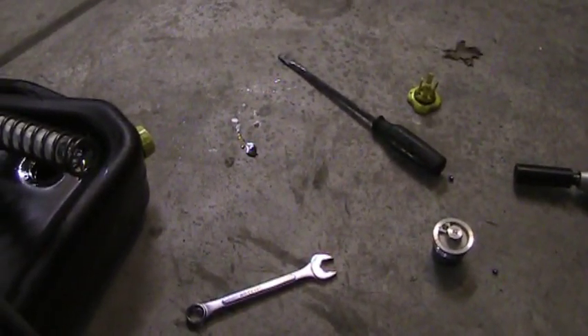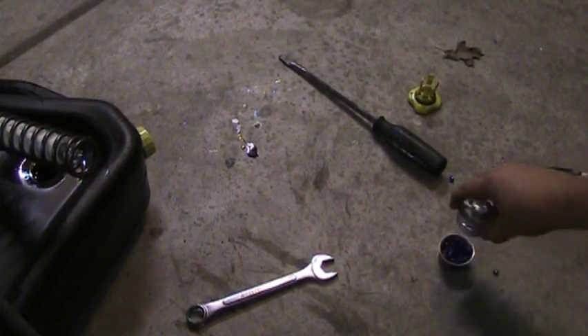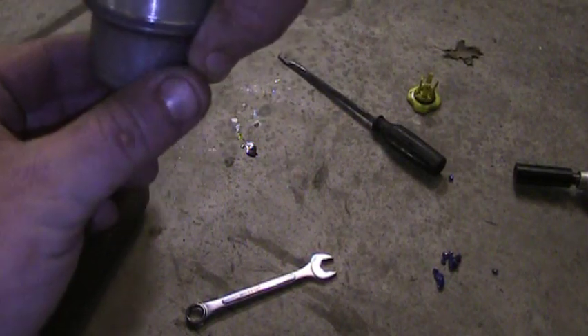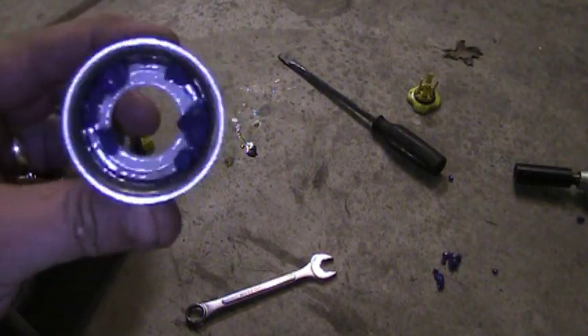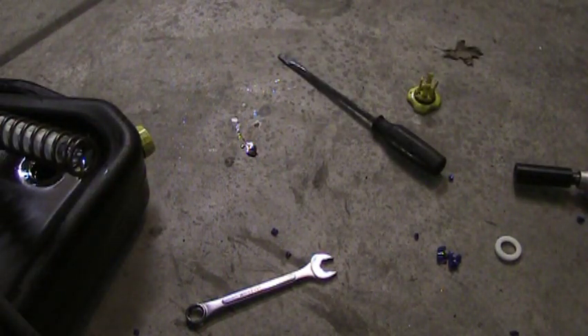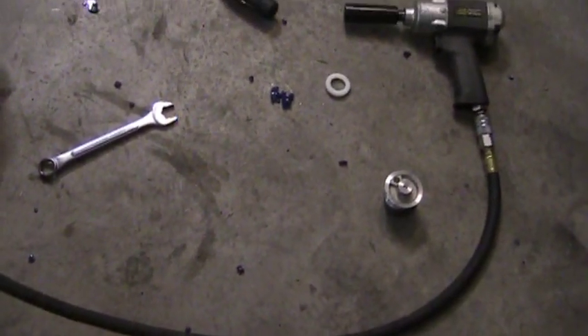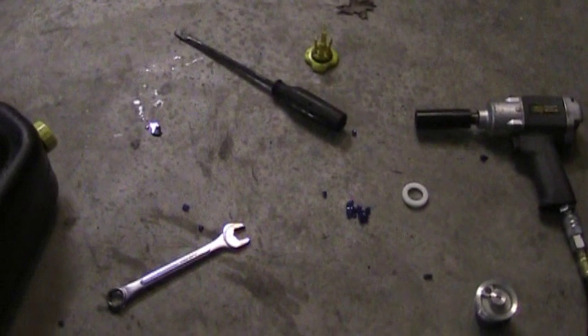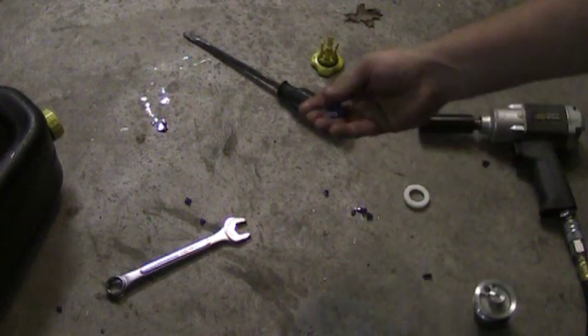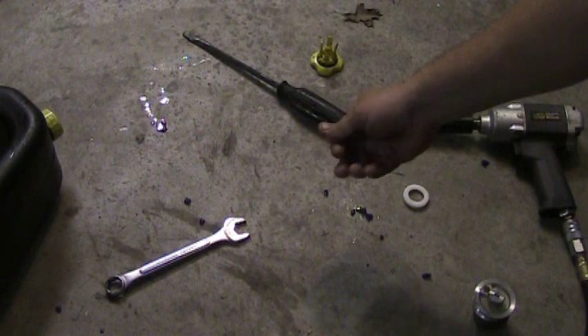When I first opened it up I was like, what in the heck is that? At the top, you've got the outer casing and then you've got a rubber bump stop. The reason why that happened — a few things: probably not enough fork oil, not bled properly or leaking, and the fact that the guy put four shims in there. Those are the stock ones, they're blue. The O3s were actually some of the better bump stops you could get. So these things would just smash to bits — I've got little blue rubbery plastic particles all throughout these forks.